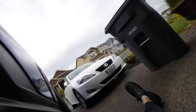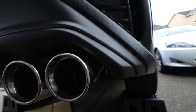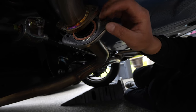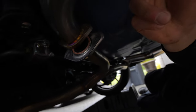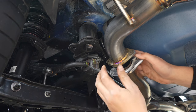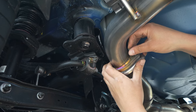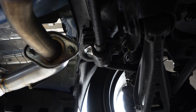The exhaust hanger is nicely centered, same with the back one. Everything on the muffler to bumper fits perfectly symmetrical, not too close, nothing touching the heat shielding — looks good. I noticed the factory graphite gasket is actually smaller than the ETS exhaust pipe, so I'm going to remove it so it doesn't fall off and get blown out of the car. Metal gasket out, line it up, hardware slides through with bolts on the back side and the nut toward the center.